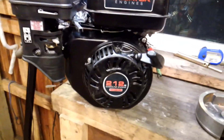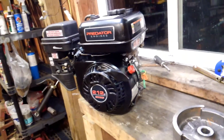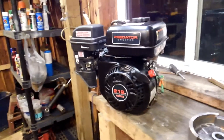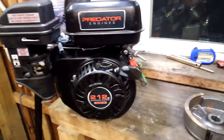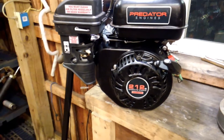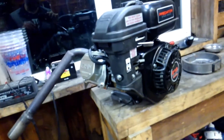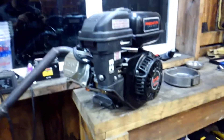It works pretty well and starts and runs no problem. It's a Honda GX 160 or GX 200 flywheel and I only have one coil in it — I know you can mount two, but one seems to be charging pretty well. There's a charging cable coming out of it. I got fed up waiting and just decided to try it, and it worked. Thanks for watching.